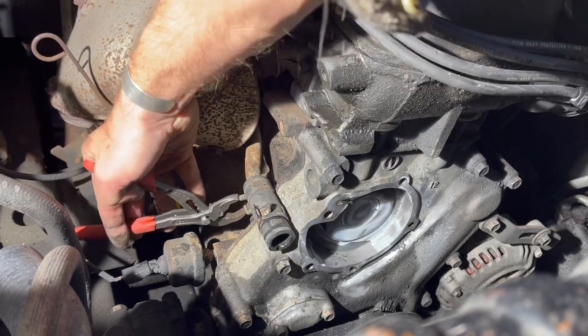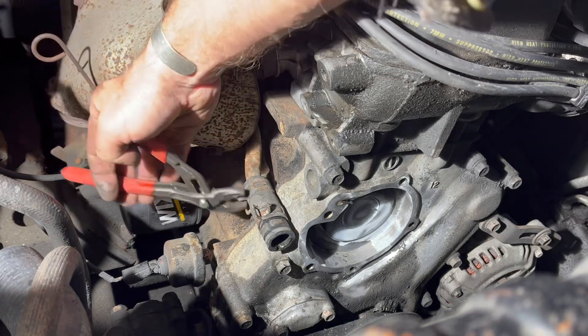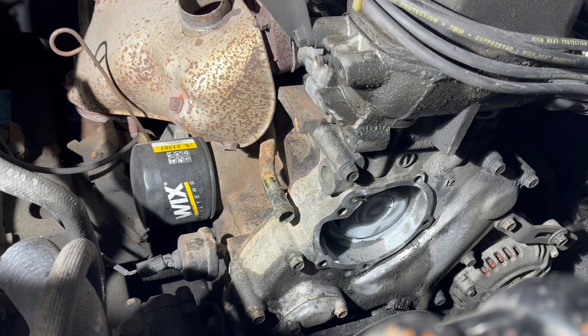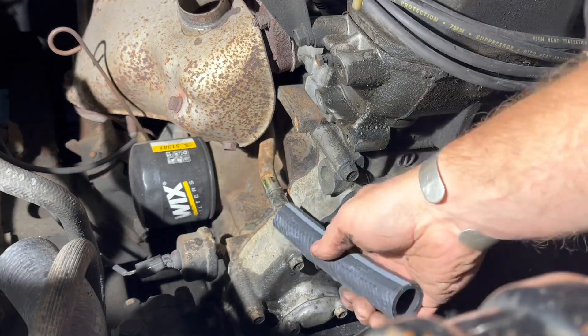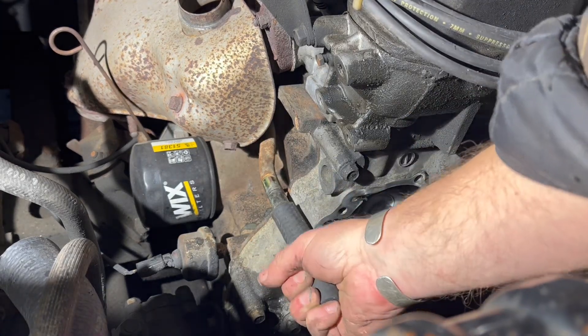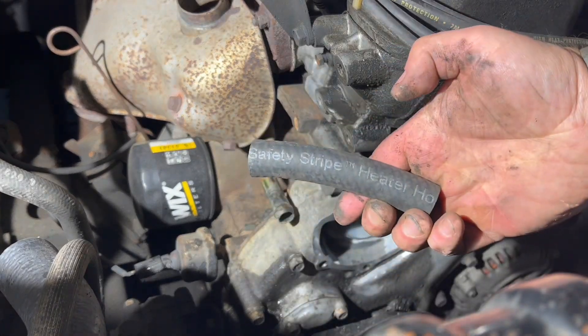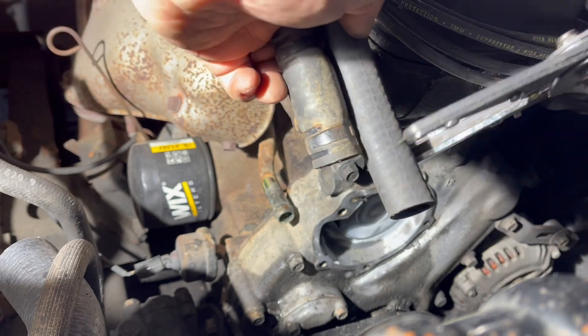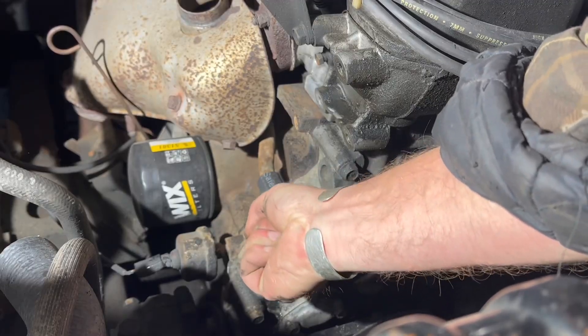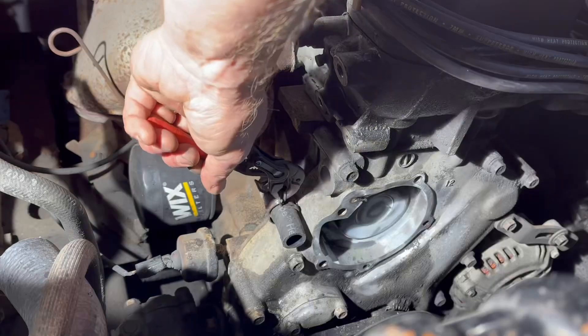Before I put that water pump on, I found that I do have some hose so I'm gonna go ahead and replace this hose. That pipe was way longer than expected. Let's see — that's three quarters... it is not three quarters, this is five-eighths. So five-eighths hose — make sure to do some very careful measurements. All the way back to your rust line, and that's all the way on right back to there.